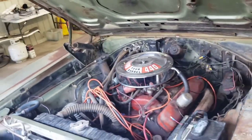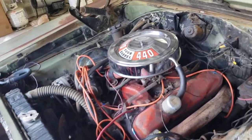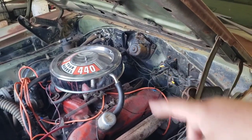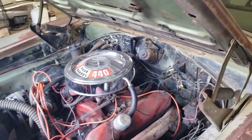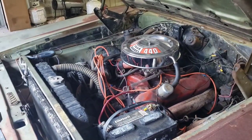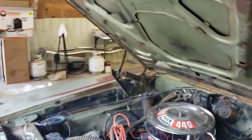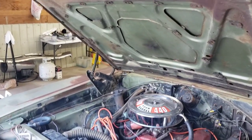I believe this may be an HP engine. It is not stamped HP there, but it's really faint stampings to begin with. I'm not going to claim that it's HP, but I was told by a friend that if it has a VIN number on the actual back of the block — which is where they're located in 68 — that it is likely an HP. I did check, and this does appear to have numbers, so I believe it might be an HP. The number guys and purists may say something else, and that's fine.